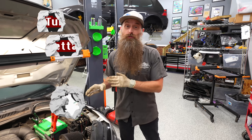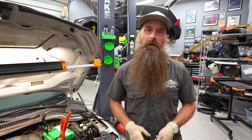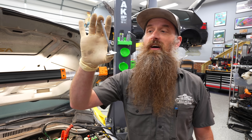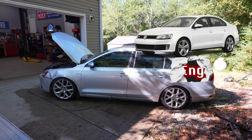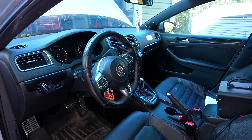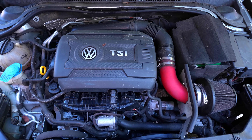Over the last roughly 20 years, this 2-liter turbo has been plagued with timing chain issues. While it doesn't happen to everybody, if it does happen, you're in for some pretty expensive repairs. In this video, I'm going to show you how to check the timing components to see if you need a new timing chain or a tensioner, so you don't end up part of the bent valve boys club or girls club. This car is a 2014 Jetta GLI with a CPPA engine code, but the steps apply to pretty much every VW, Audi, Porsche, Skoda, SEAT around the world that came with any variation of the EA888 engine - the 2-liter turbo as well as the 1.8-liter turbo.